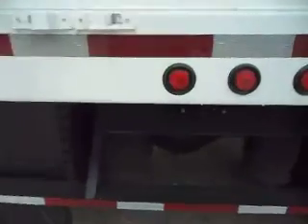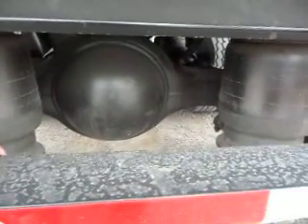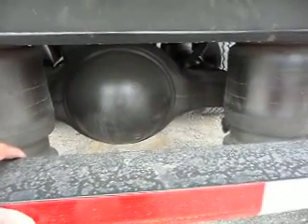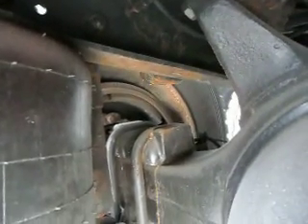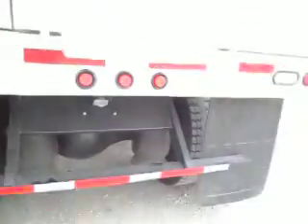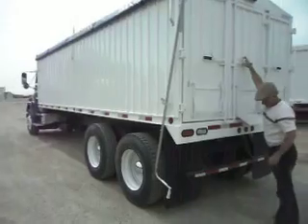I'm going to pop on down and show you some things underneath. When last have you seen an undercarriage and differentials with no rust on them like this? This sucker is clean. Nice four-bag air ride suspension — it has a suspension dump valve built into the dash, I'll show you that later. Take a look in here: the brakes are somewhere at 60 to 70% remaining on the drive axles — very nice and clean underneath. The chassis has not been painted to obstruct your view of seeing what this truck actually is. The body itself is brand new, along with the hoist.